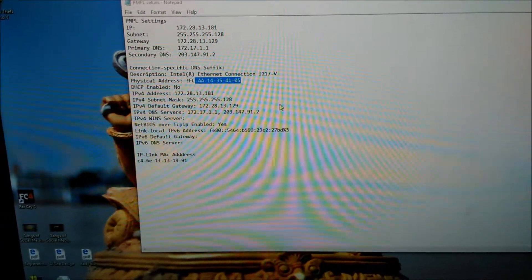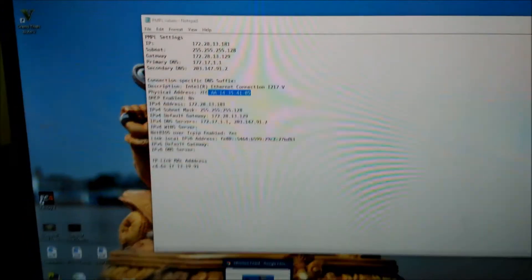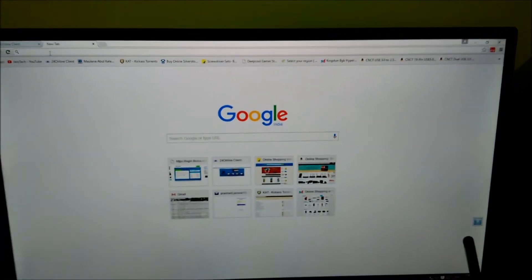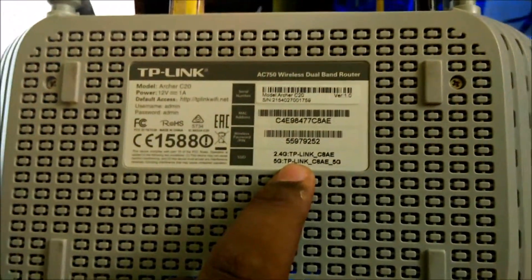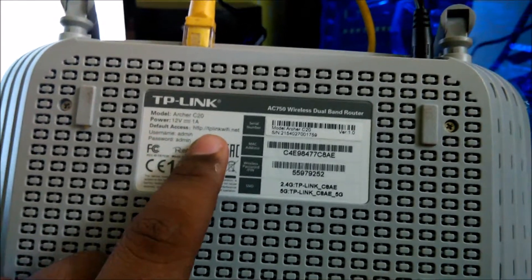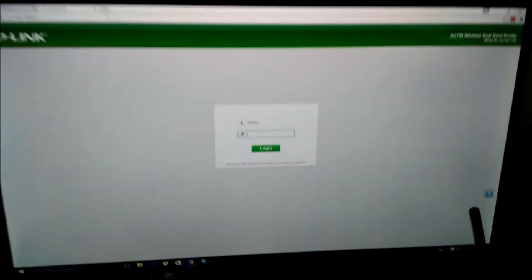Note your MAC address as well. Now disconnect your existing Wi-Fi and connect to the TP-Link network. You can find the SSID and password on the sticker on the router. For Ethernet connections no wireless password is needed. Access the router admin panel at 192.168.0.1 — the default username and password are both admin.